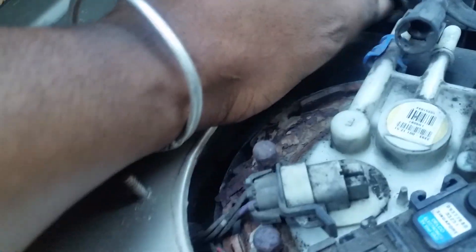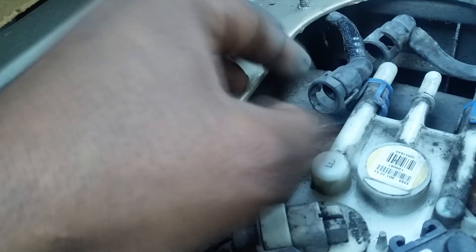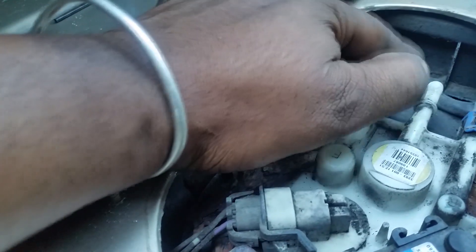There are connections here, here, here, and here. These are snap-in connections — if you pry down right here you'll get them off. Now there are three hose connections: the first hole you take off has two squeeze connections — squeeze from both sides and push it out. The lock ring connection you squeeze these two sections together. The last one is the hardest because of the lip — use a dental pick or an allen wrench, scoop it up from the bottom, press it in from the side underneath, then push out and it'll pop free.